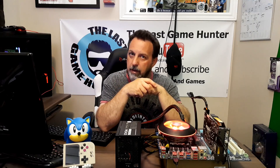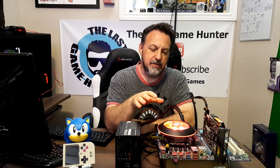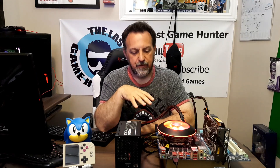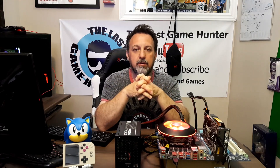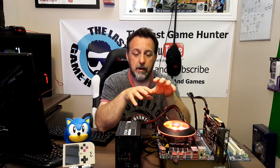Sometimes cool ain't cool — my brother gave me that one. That concludes my review. Cons: if you have high memory sticks, this is not for you. Pros: I did find there's more space between the RAM and the cooler than I expected, but still not enough to clear RGB heat sinks. On the build: I've mounted a lot of aftermarket coolers and didn't have to pay much attention to instructions — but make sure you pay close attention to the instructions on this one. There are a lot of different little things, especially specifically for AMD and which version of AMD you're mounting.